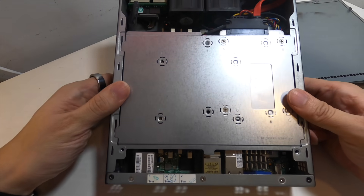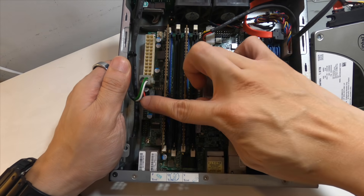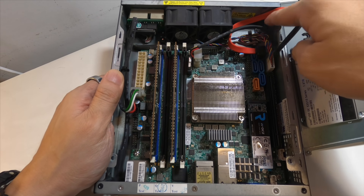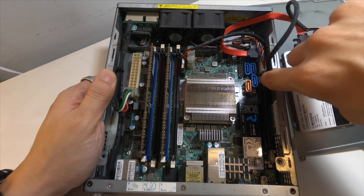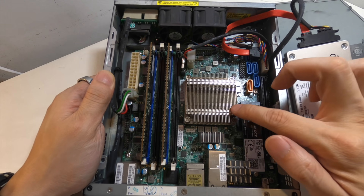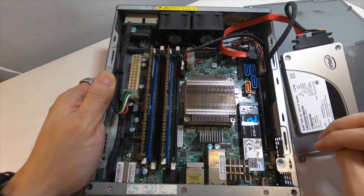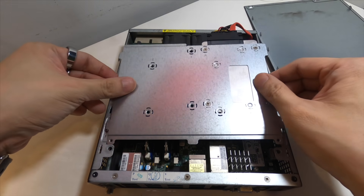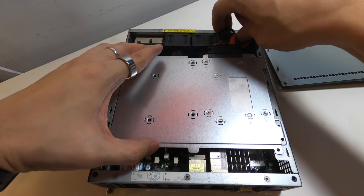Getting into it, as you can see it's very tight from a space perspective. There are four DIMM slots — I filled two banks with 32GB sticks each, a little pricey but worth the money. There are two fans, and you can actually put one more in, but it's very tight with cable management, so probably not a good idea. There's an NVMe M.2 slot and a PCIe slot hidden here — you can use a riser card to add another NVMe. There's also a passively cooled version, and a version with an active cool CPU where you could potentially remove one fan, though they are pretty loud. Then there's one SSD. There's a cutout for another SSD, but it's fairly useless because once installed it hits the RAM slots, so unless you have no RAM — which is unlikely — those are pretty useless.